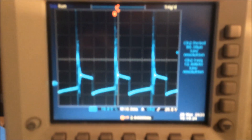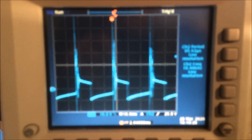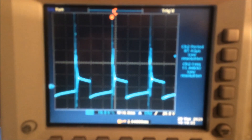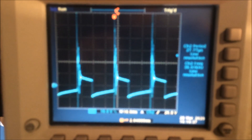If you look carefully, you can see the high voltage spike before breakdown on the spark plug, and then you can see the recharge of the coil on the low side, which is dwelling — how long it dwells during the charge.